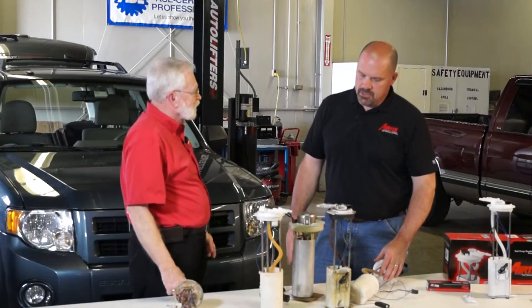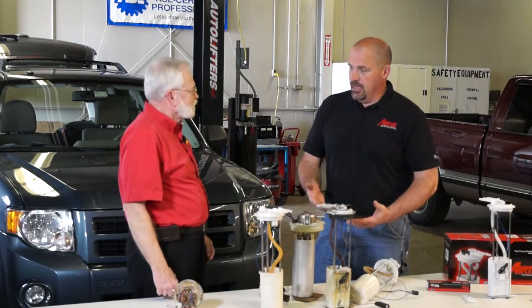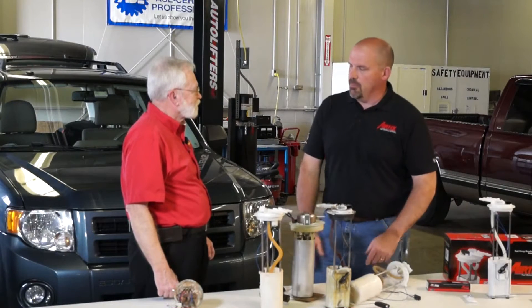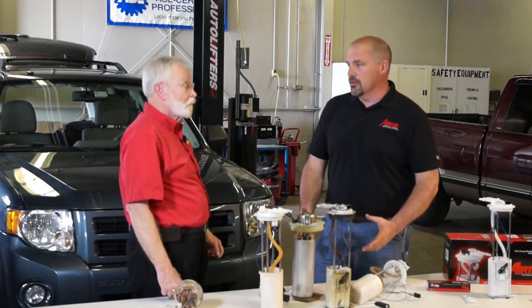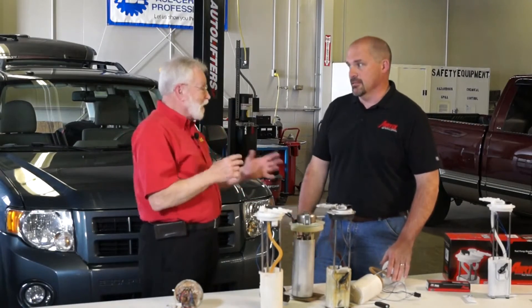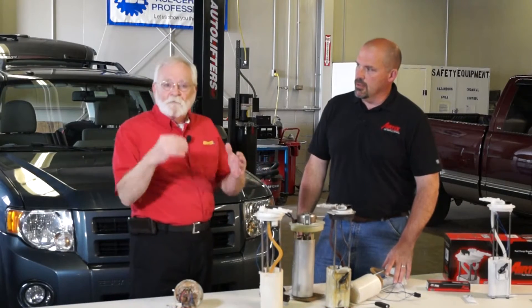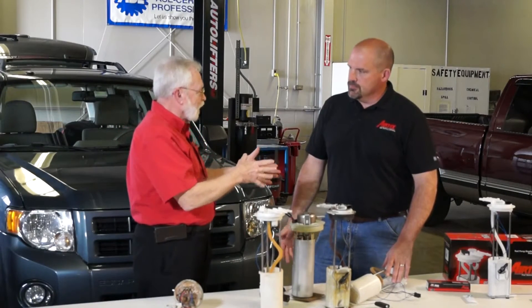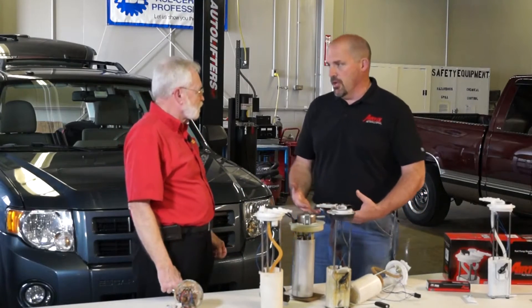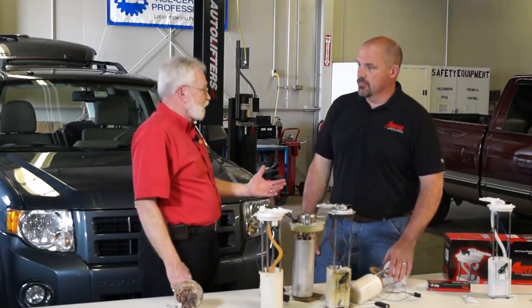Well, Jim, that's an interesting question. A lot of people look at a fuel system, look inside the tank, and really don't believe that there's any contaminants in there. But you're talking about a pump that operates at less than half a thousandth tolerance. So a little bit of grit can really cause a problem. Less than half a thousandth — that's really, really pretty small. Any amount of grit whatsoever can get in there and start to cause problems. You are going to see some contamination go through the pump, and the pumps will handle some. But when that level of contaminants gets too high, it just eats the pump up.